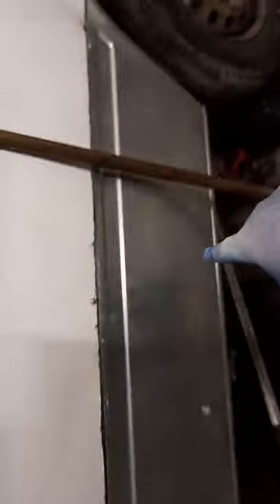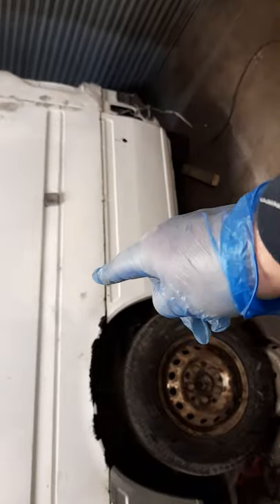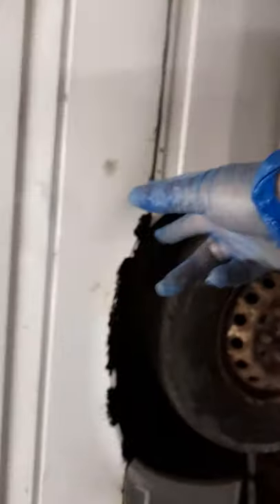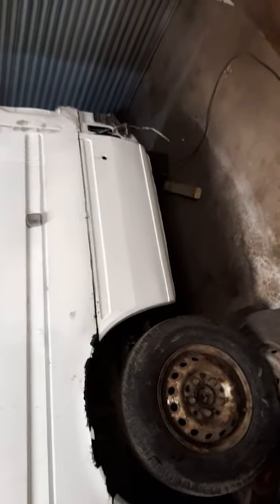This thing I keep going on about - the galvanized steel. If I put this back section on, and this is why I'm filming as I come into the workshop rather than showing you the end result: when you start tacking this all up, welding isn't the only job. You need to grind it, you need to get fiberglass along anywhere you've welded, seam seal down the right edge, seam seal along the inside, then get back in the van and get corrosion protection on any sections that haven't been protected.